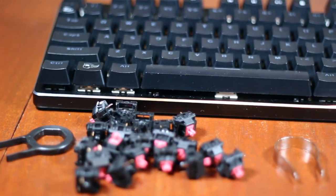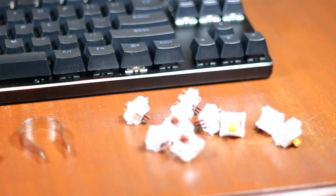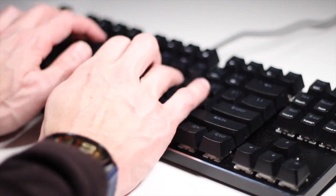The default switches in the GMMK are Gateron Browns. While I prefer Gateron switches over Cherry generally because of smoother keypresses, there's not a huge difference between Gateron Browns and Cherry Browns aside from Gateron being less scratchy. In my opinion, you're better off buying switches independently of the keyboard. The typing experience on the GMMK is pretty much identical to other plate-mounted keyboards — keypresses are solid, without rattle, and the overall experience is about what you'd expect from a high-end keyboard.